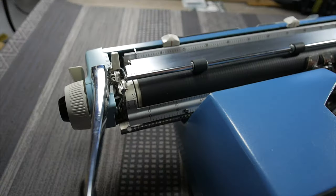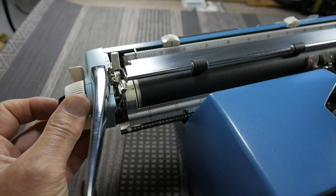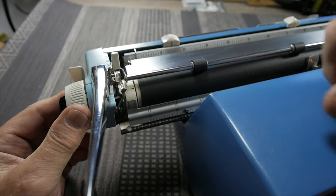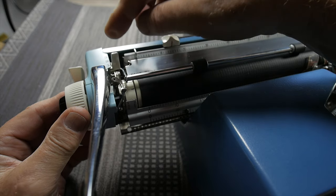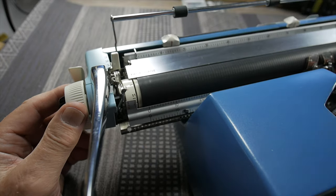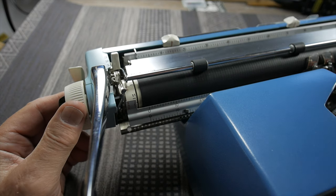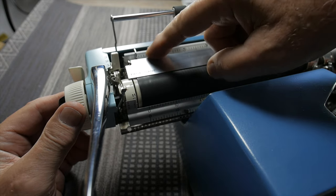On the left side of the platen you have a nice long shapely carriage return lever and your left platen knob. This button in the middle is the clutch release for the line space variable, and this is the permanent adjustment for it. This little lever is the temporary release of the line spacing ratchet — set it back and you'll restore your original line spacing. These Smith Coronas have one, two, and three line spacing, so in one line spacing it's a single click of the ratchet. Right here is your typical Smith Corona end-of-page detector — this little roller on the end of the platen with the numbering system. It's handy if you're used to it; I don't really use it because it's kind of kludgy in my view.